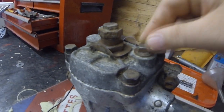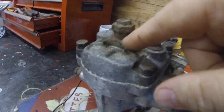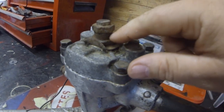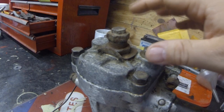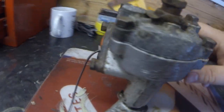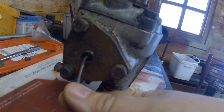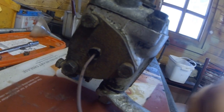As you can see here, that looks like some sort of a filler plug there. This is obviously an adjuster nut — there's the lock nut there. So that tab's got to be bent down, undo the lock nut — it's very corroded by the looks of it anyway. Coming around the front there, these are just three bolts there. That wire there — I didn't realise what that was at the time, but that is the actual horn wire that goes to the horn right the way up the column. So that's okay, I know what that is now.